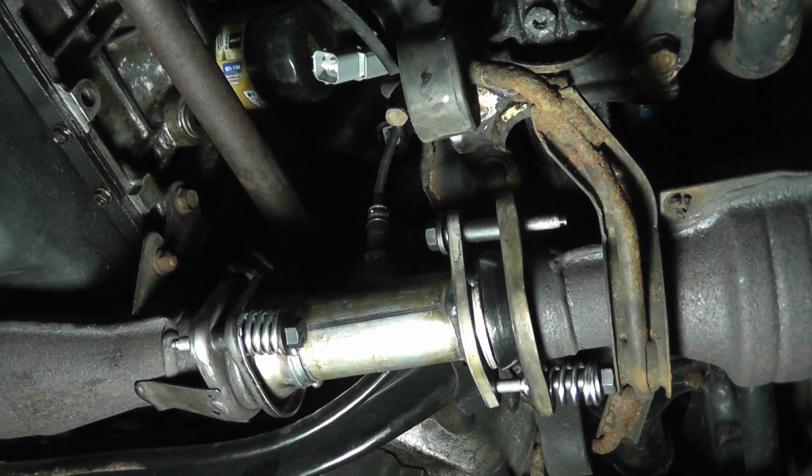In other words, the two holes on the mid-pipe flange were too large. I thought about using washers to make it work, but all too often when you start modifying parts, you find out that other things make it incompatible, so I decided to get a Bosal mid-pipe that fit properly.